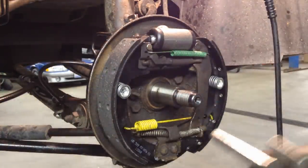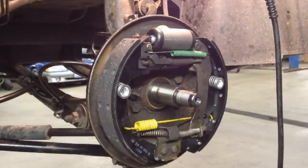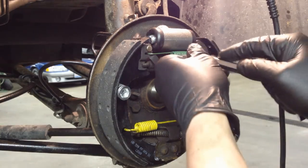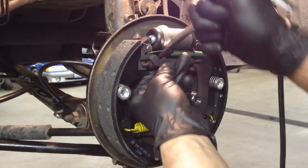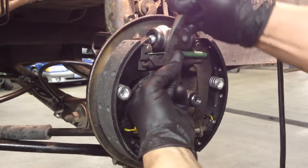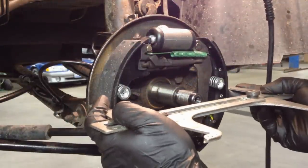For adjustment, you definitely need to do an adjustment. These need quite a bit because they're aftermarket — you have to go all the way in just to fit the drum on. I have a fancy tool that measures the inside diameter of the drum. Walk over and adjust the star adjuster, then keep checking. Adjust it out a little bit, keep trying the drum on there — it should drag on there just a little bit and that's how you know you're done. Make it nice and snug so your parking brake works and you get a nice pedal feel.